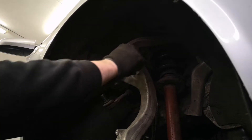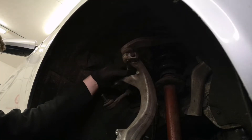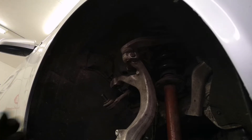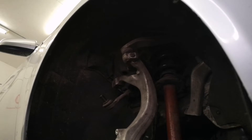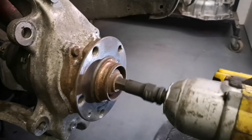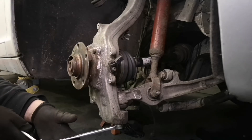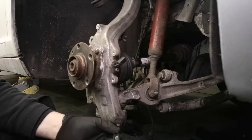It wasn't the best design of theirs, this pinch bolt — the fact it goes through two ball joints makes it quite difficult to get out if it seizes. Obviously this is aluminium, not steel, and the two naturally corrode when you put them together, so yeah it wasn't the best idea. But hey, I forgive them. Nice and tight, that's that back in. The lower ball joints — FT as everybody knows stands for fairly tight — I believe anyway.